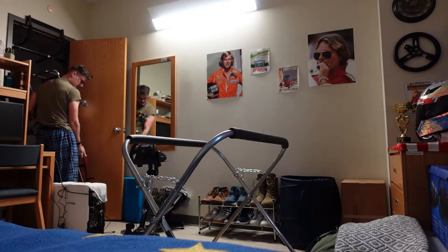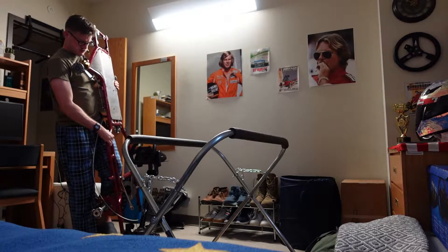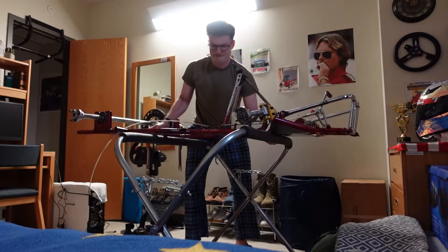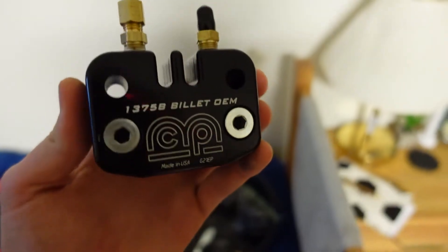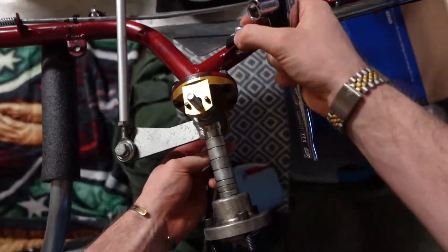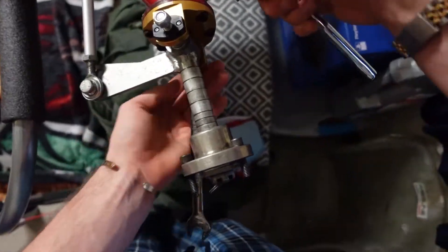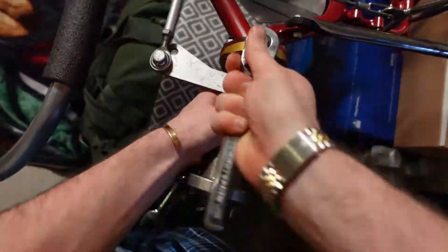Another day, another dollar, another go-kart in my closet. Taking her out — my shoulders hurt, it's heavier than it looks. I got new brake components — I tried to rebuild the old ones but they were so old I couldn't manage it. It's nice to have brakes that work so you don't fly off the track. These are the camber pills for the Coyote cart — camber controls the lateral angle at which your tires are. I got new camber pills for both sides so they were even, putting them on so the front geometry is good to go and basically race-ready.